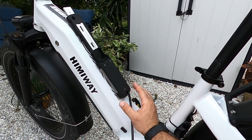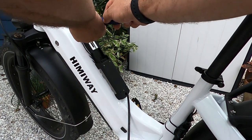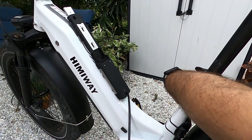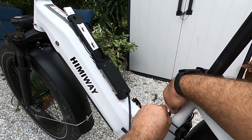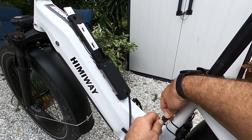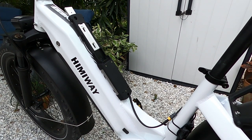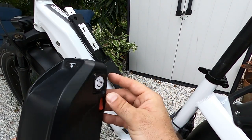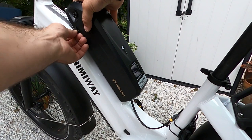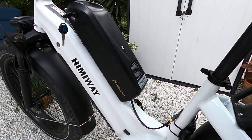This area right here is our clearance measure. We put the extender on here to move the battery cradle up so it didn't hit on the body. We've previously covered our ends — I like to do this as a precautionary measure just in case. We'll go ahead and plug that in. We check that the battery is on, then turn it off, get it onto the cradle, close it up, and lock this thing. It looks like we are good to go.